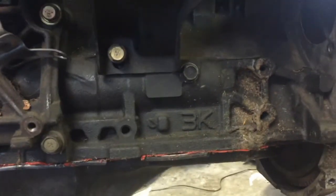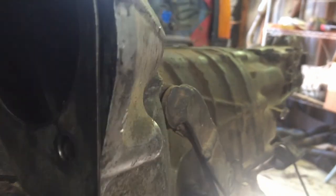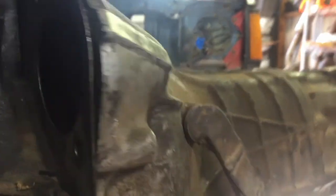Another issue is that the truck starter doesn't quite fit through the metal shield that goes between the transmission and the engine — it's shaped just a little differently and the edge hits just a little. What I'm gonna do is drill out the holes from this side so I have perfectly matching holes, and then bore out the border a little bit with a Dremel or a drill bit. It should fit after that, but unfortunately I'll have to take the transmission off to do that part.